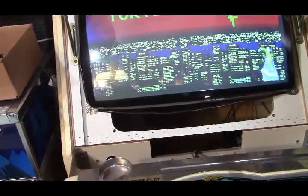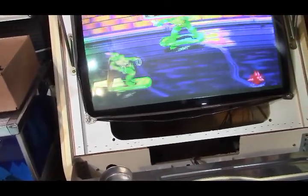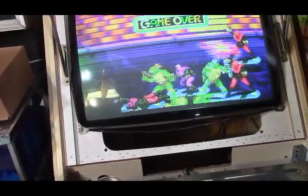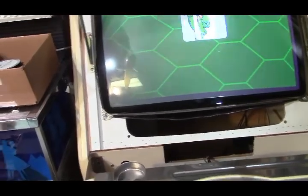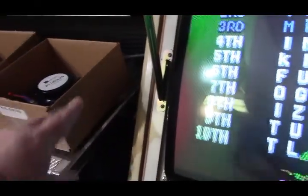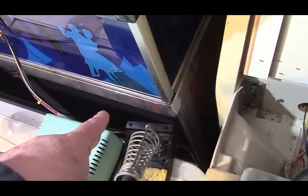Also, a permanent magnet or electromagnet — any type of magnetism that gets close to it — can cause this discoloration. My viewer commented that he thought these speakers I had sitting next to the monitor might be causing this. I wrote him back and said no, I think this is leftover from that lightning strike I had. I did degauss this with my degaussing coil, but sometimes you have to do it two or three times. Then I got thinking — it is in rather close proximity to the monitor, and also it's right next to my jukebox, which has rather large speakers with big magnets on them.